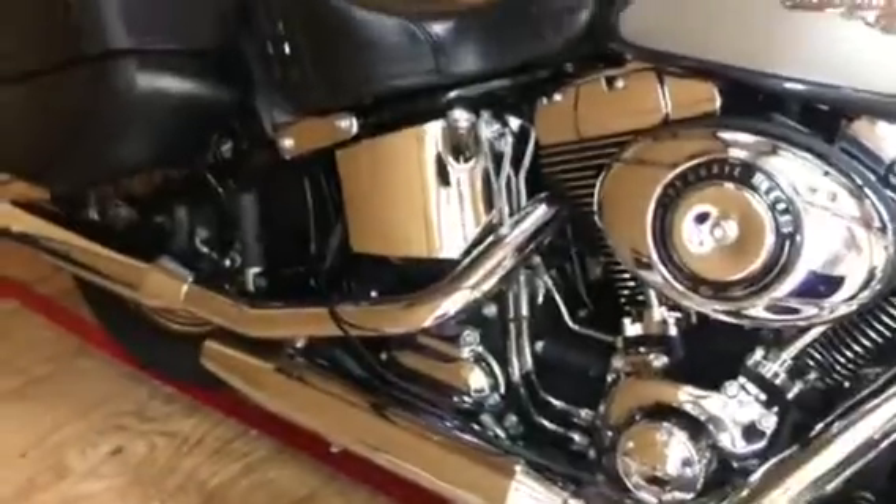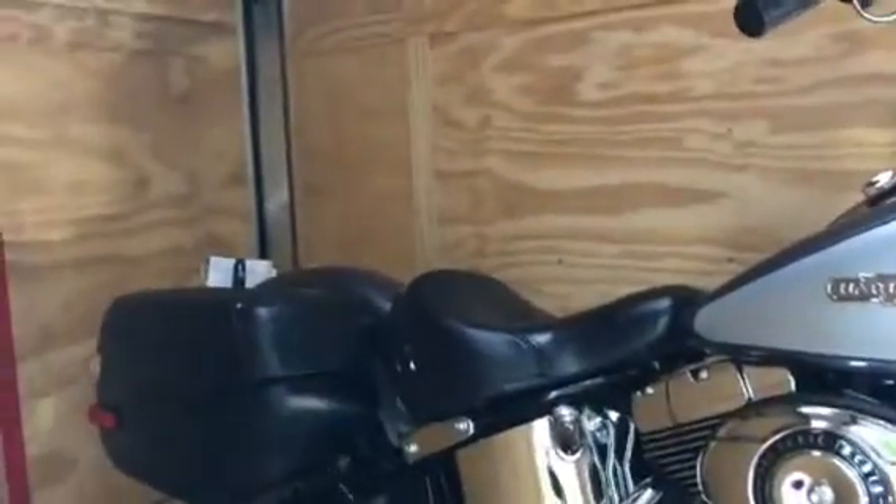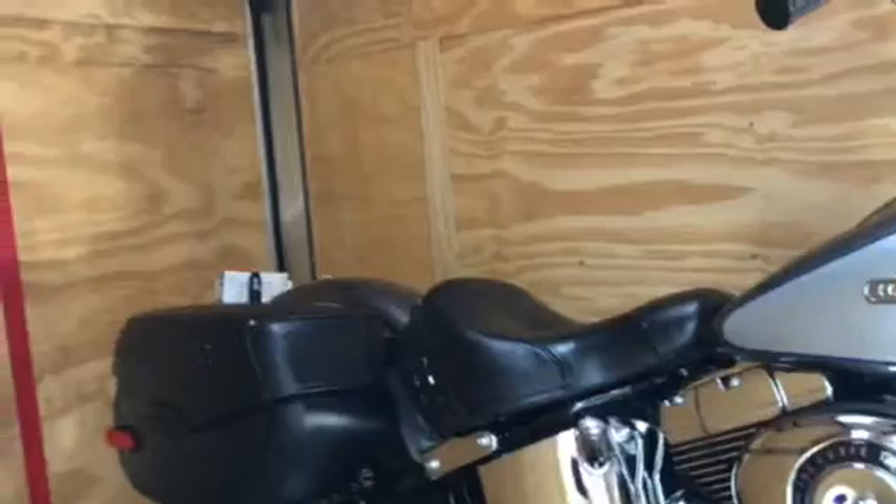I also found out the front two, I had to cut them off a little bit, about a half inch. Those plastic things were poking down where these grommets were plugged into, and the seat would not come down. So for the front two ones, get a Dremel and cut about a half inch off each one of them, then take the grommets out of the others.